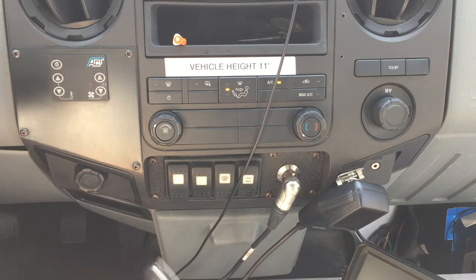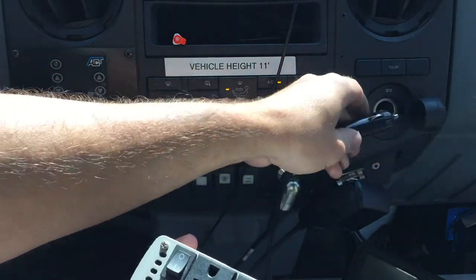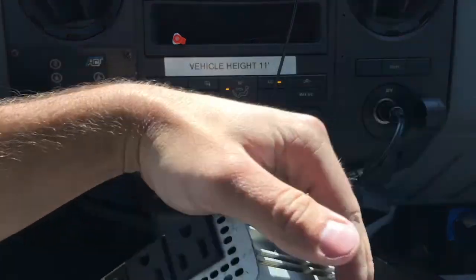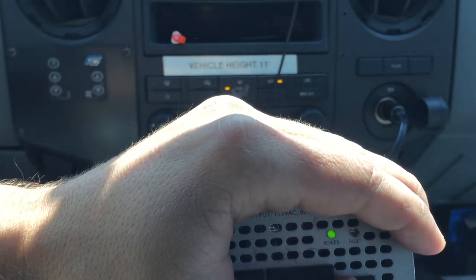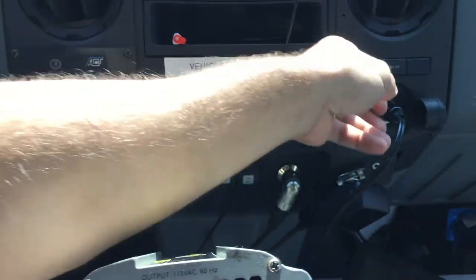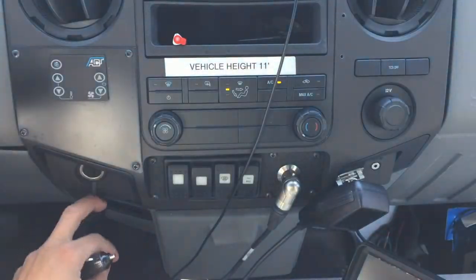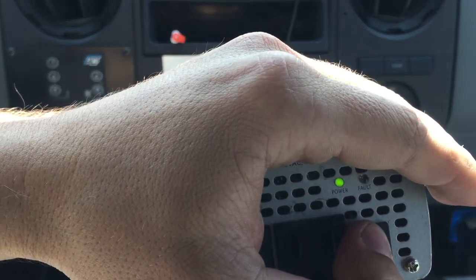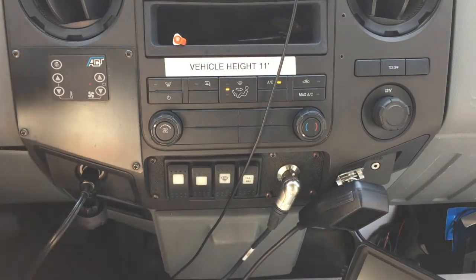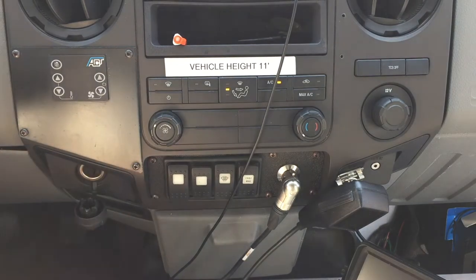Back in the vehicle. Let's plug it in again. Make sure this one's still working. Plug it in — we got power. Let's try the other side. Plug it in — we got power. We fixed it. So 83 is the driver's side fuse for the 12 volt outlet.